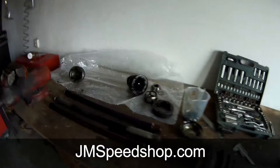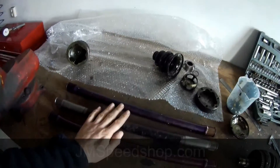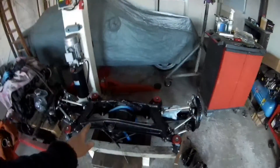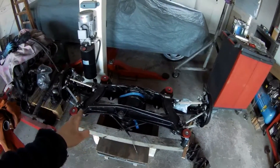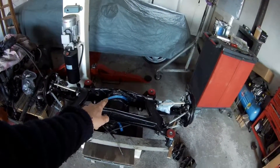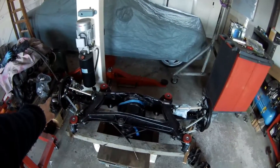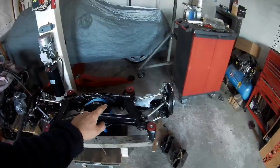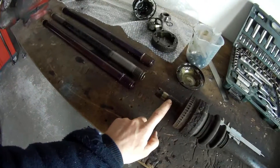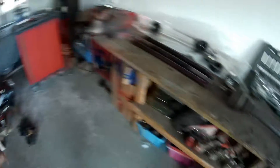So, the axles. For those who didn't see the other videos — I have a W124 rear subframe, modified to fit an S210 or W210 differential in the back, with S210 rear wheel hubs. The axles going in there are from a W220. They have the same diameter as the S210 — that's two millimeters bigger.